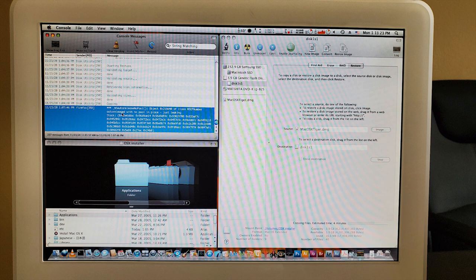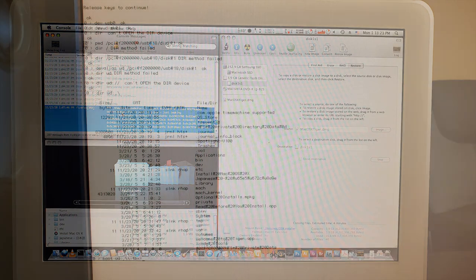To do this, I downloaded a Mac OS X Tiger ISO file, which I'll link in the description, and converted that file to a disk image using my iMac G5. After doing this, I erased my USB and formatted it as Apple Partition Map, which you'll need in order to boot on a PowerPC Mac. After this, I restored the image to the USB using Disk Utility.